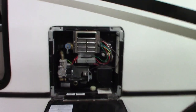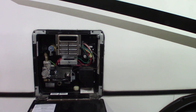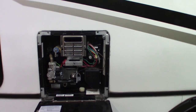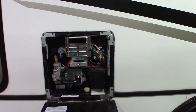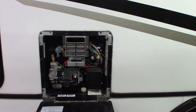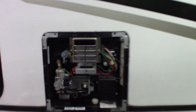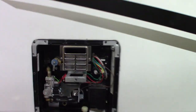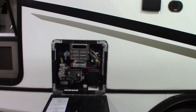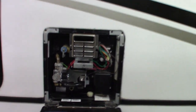It's bypassed right now because this trailer is winterized. Keep in mind that this runs on either gas or electric. So when camping season comes around and you de-winterize the trailer, make sure you put the bypass valves — on the back of the water heater — in the correct camping position. Put your cap on the drain, then fill up the water heater tank and turn on whatever energy source you're going to use. If you use the electric heating element, it can burn out very quickly, so always make sure there's water in there before you start using it.